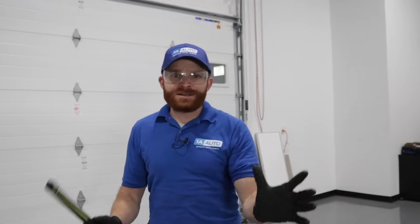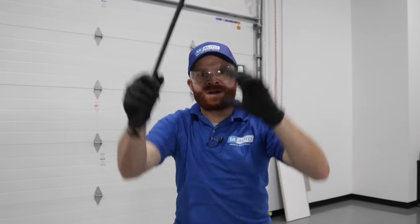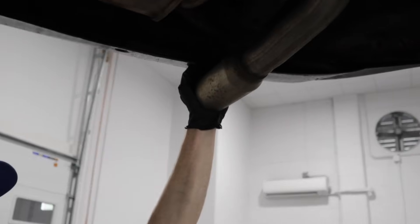Sometimes they're going to be a little less apparent and sometimes they might even be a little hidden. Essentially you just want to start up the vehicle and then listen — see where that exhaust leak sounds like it's coming from. Is it coming from the back of the vehicle or the front? It'll kind of give you a starting point, but the best way would be to get underneath the vehicle — put it up on jack stands or on a lift — and come right over to the tailpipe and try to cover it.